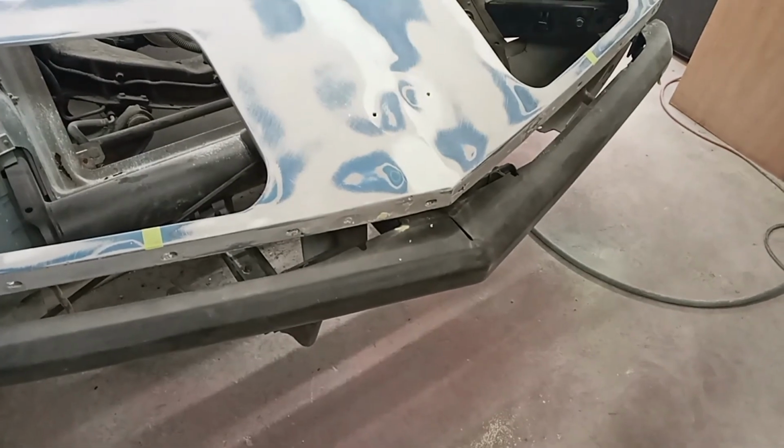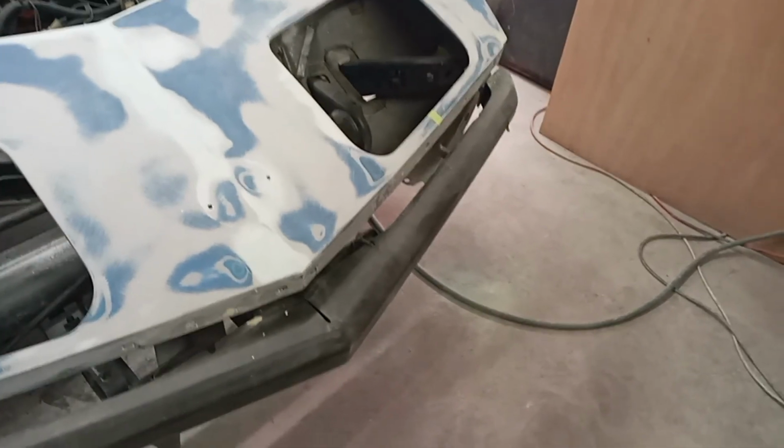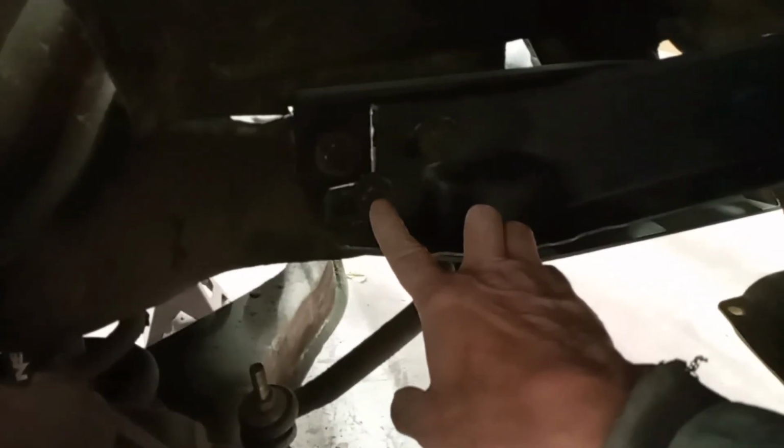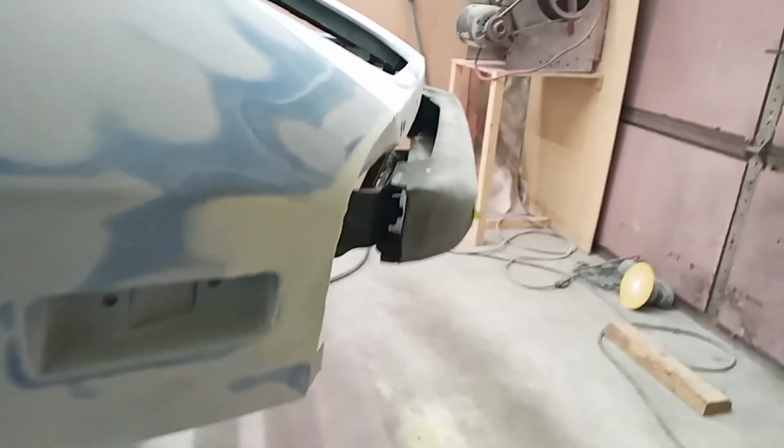And then up the front, I've put the rebar back on, got it all lined up, and there has to be a difference in that front bumper, the shape of it or something, but to make it fit with that bumper in place, this is the support brackets. I elongated these slots out about a half inch to allow these brackets to come back, to allow that rebar to move back so it will clear the bumper. So this game's not over yet. I've got some cleanup to do.